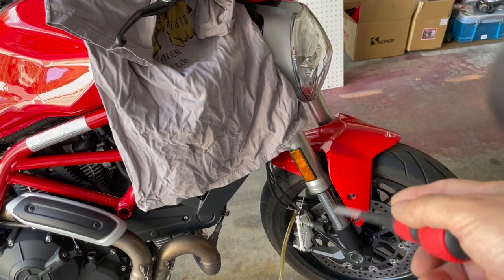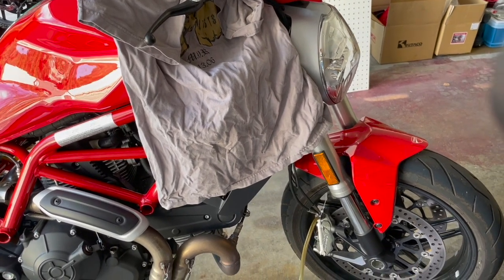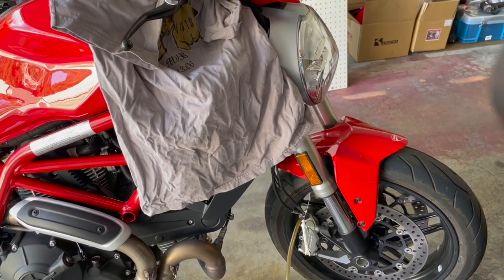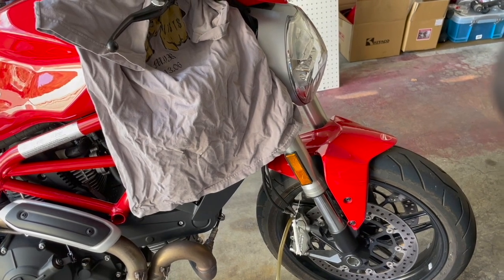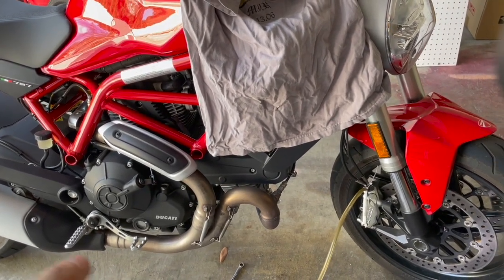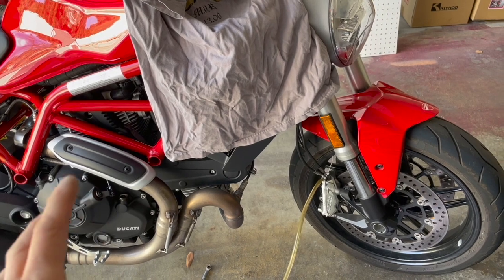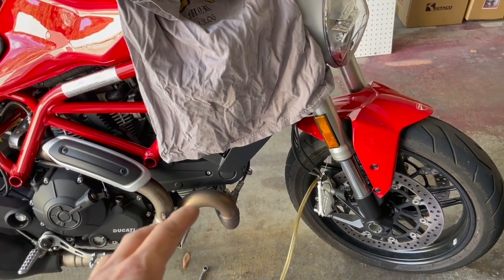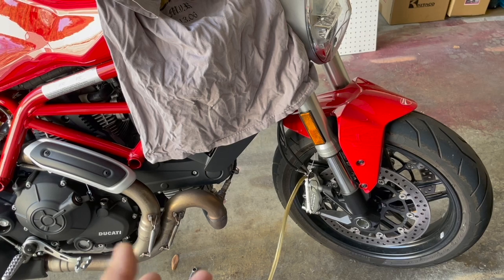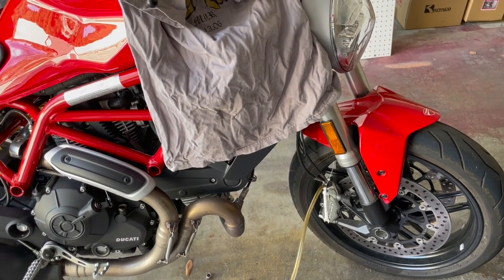It's a 2018, and I'm thinking the brakes have never been bled. Normally manufacturers for motorcycles say to bleed the brakes every two years. I like to do it every year, after the rainy season — usually at the end of spring or early summer. Rain is over so less water gets absorbed by the brake fluid, and you want fresh brakes for summer because everything gets hotter and brake fluid is more likely to boil.